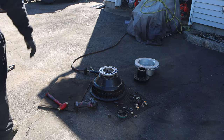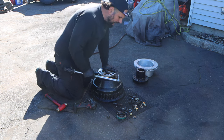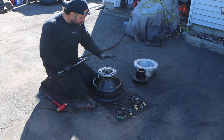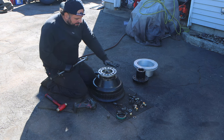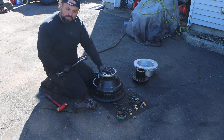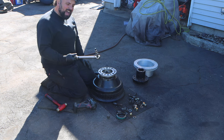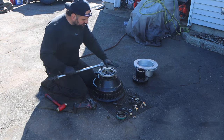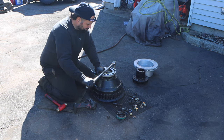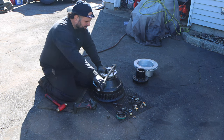Alright guys, pounded out all the studs once again. Now this is the one we're going to have to re-torque. I called the guy at TSM and he confirmed: yes, you are supposed to torque these down to 80 foot-pounds. Originally these would come separate, but shops couldn't figure out how to install them, so he installs them for you. You'll need a 3/8th Allen head — set your torque wrench to 80 pounds, flip this over, put the stud inside the holes, and torque it down to 80 foot-pounds each.